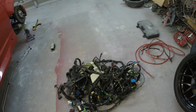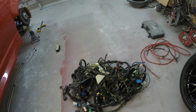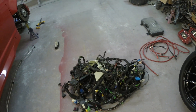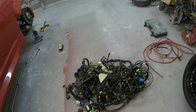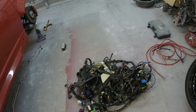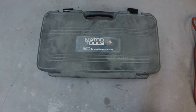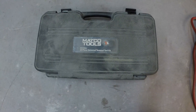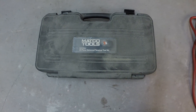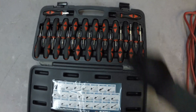Like everything for the headliner, sunroof - this car doesn't have that anymore. All the airbag stuff's coming out, all the radio wiring, speaker wiring - all that stuff that this car is just not going to need, I'm going to remove from the harness before putting it in the car. To de-pin all the wiring, this Matco universal terminal kit has by far been the best tool that I've bought for this.